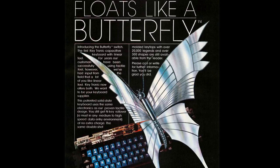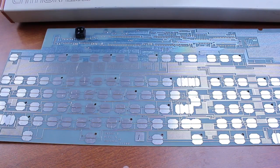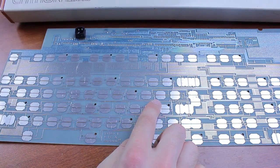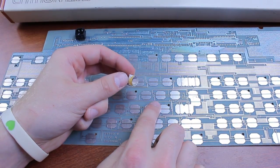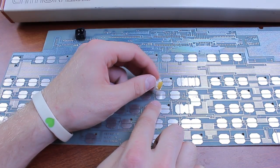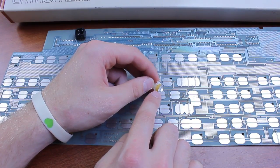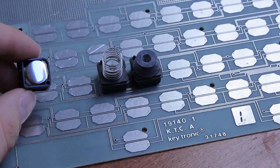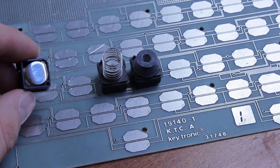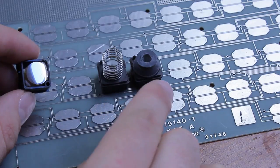I love that retro 80s look though, and those keycaps! The switches are discrete modules and they basically work as follows — I'll use one of the shorter modern versions to explain it. The keyboard's PCB has two separate capacitive plates on it, and above that sits a foil disc which, if you push a key, is pressed onto the plates and their capacitance changes. To allow for over-travel and presumably to make the manufacturing tolerances a little bit looser, the foil disc sits on a foam pad that is affixed to the slider. This is where the term 'foam and foil' comes from, because basically the whole inside of the switch is taken up by the foam and foil assembly. There is no room for an internal spring, and as a result foam and foil switches are almost always seen with external return springs such as the coil spring and buckling rubber sleeves.